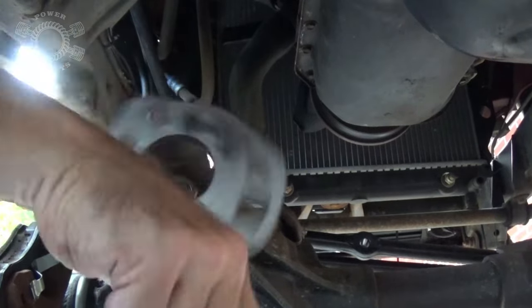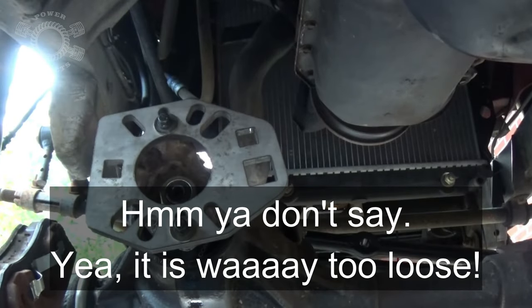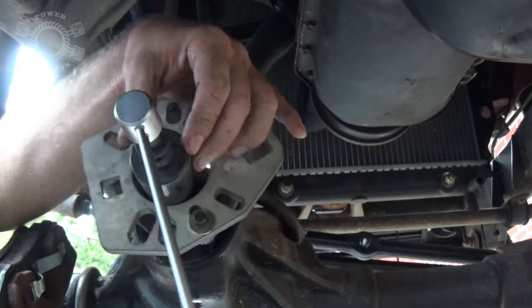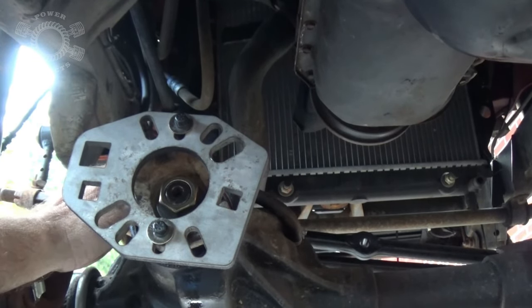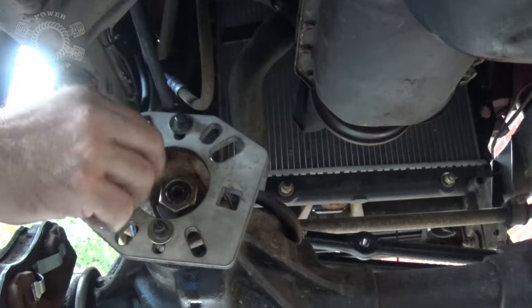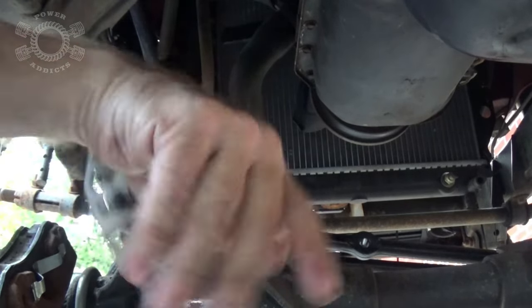Okay we're tight. I spin it and honestly that feels loose. Get my little torque wrench - oh yeah that's way loose. We'll put the 15 in the end that we matched on this side over here, plus we'll put in about another 10. What do we do? Let's take out five - that one little bit of thin shim, take it out, put it back together, and we'll test it again. Baby steps.